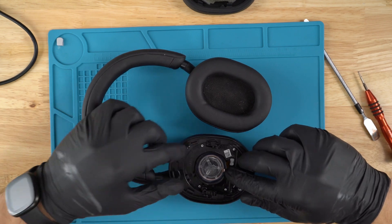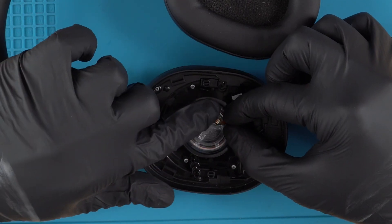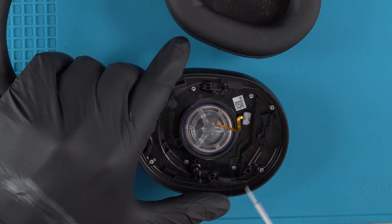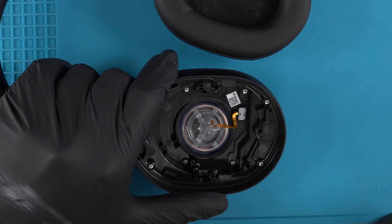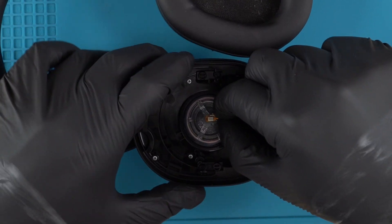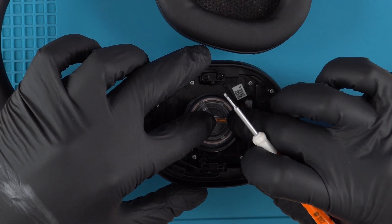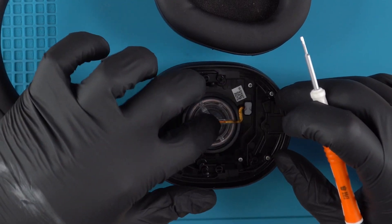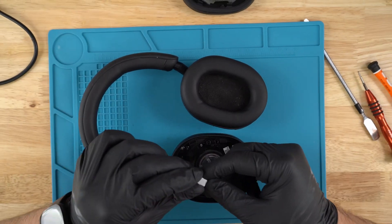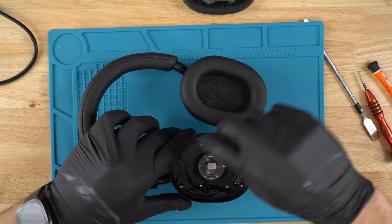We have to make sure that we put the MS ribbon back onto the speaker. If you pay attention closely, the MS ribbon has a little hole there and there's also a little pin right there on the speaker driver. Get those two lined up and it's smooth sailing from there — line it up and seat it down. There should be some adhesive on the MS port ribbon, so once you get it down in there just push down and make sure it's on there. Then place the little rubber gasket back on and make sure it's in place.